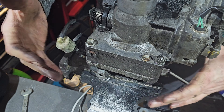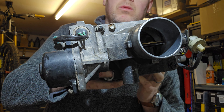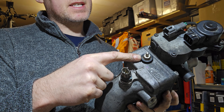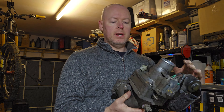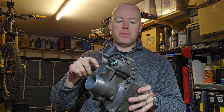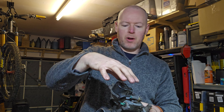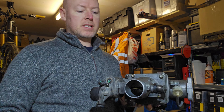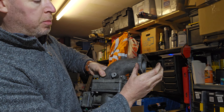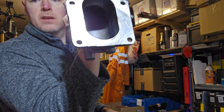I'm not going to snuggle all this tight because this isn't the piece that's going to go back on the car. The butterfly valve is still there, and through the inside of the intake elbow there's now no restriction. Another thing I'm worried about is this electrical connector — hopefully I don't have to bolt the loom back on there and I won't throw any engine codes, but I'll let you know. This is from a different Land Cruiser. The butterfly valve and what's in here I don't want to swap from one vehicle to another — all I want to do is move the machined metal plate. What will happen next is when I reconnect this to the car I'll have that Toyota machined EGR block here.